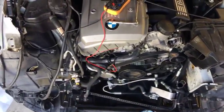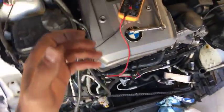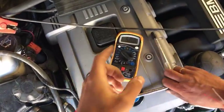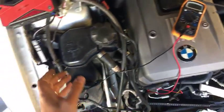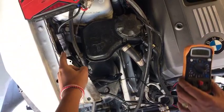You could cut your fingers on the belt. You don't have to take all that stuff apart — we just did it because we're rebuilding the car. You have to set the voltmeter at volts. You have to have the black wire of the voltmeter connected to a negative ground on the vehicle.